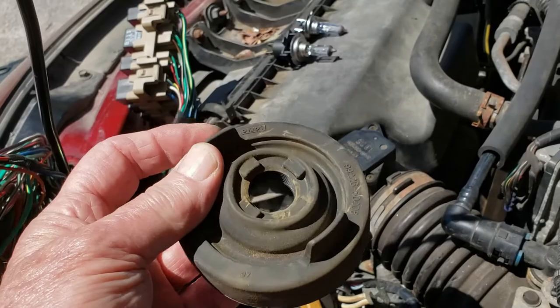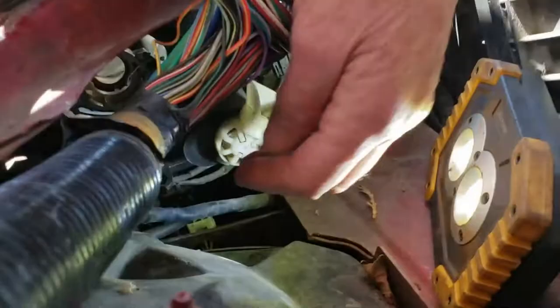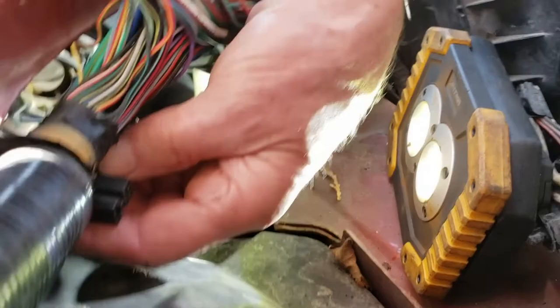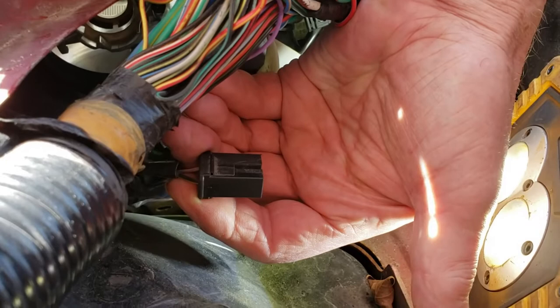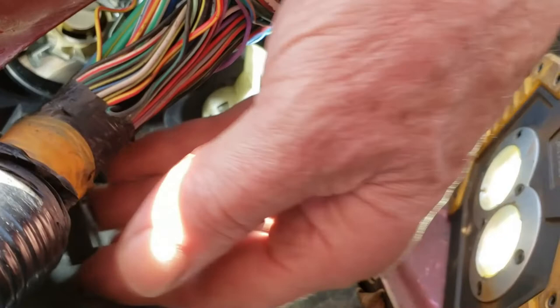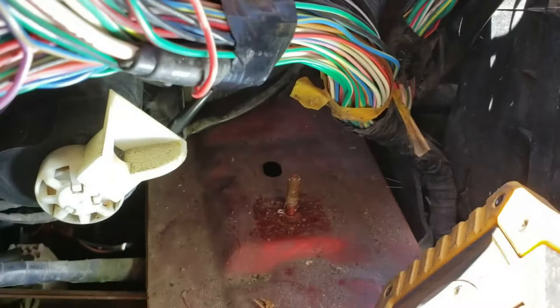There's no clip on this connector — it is just a bayonet that is pressed on. And there it is. So as I say, this bulb is held in; the assembly is held in with a spring clip. The high beam is much easier — it just twists out. You have to take off this yellow connector first of all and then it'll twist out. So I'm going to stop filming right now and see if I can get hold of that clip.